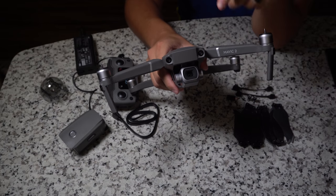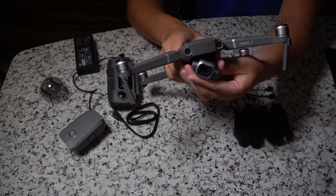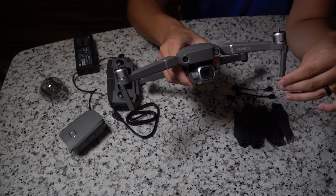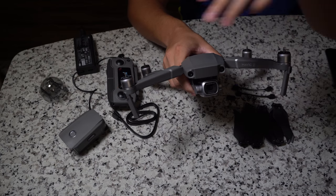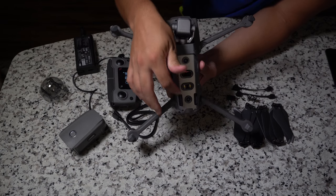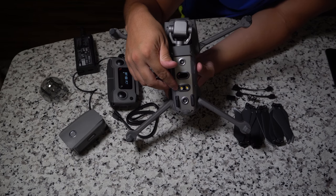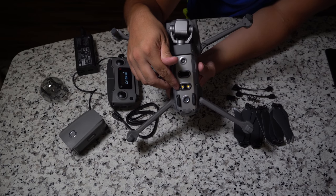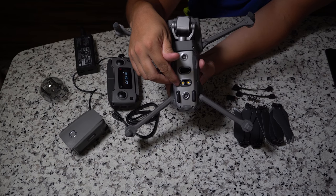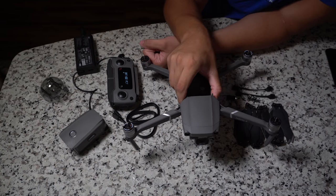The front of the drone looks very similar to the original Mavic Pro: two sensors up top, your gimbal and camera assembly, the beautiful new Hasselblad camera, landing gear which doubles as antennas, two lights, and the front set of motors. On the bottom we have two cameras, infrared sensors, and new LED lights which can come on automatically, be turned off completely, or turned on manually. These are beneficial for lighting up your drone when flying at night or when landing, providing extra light for the sensors.